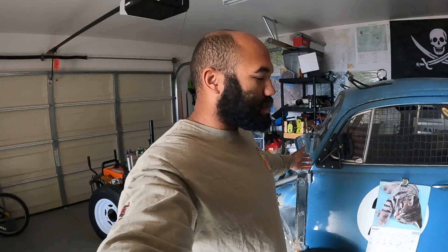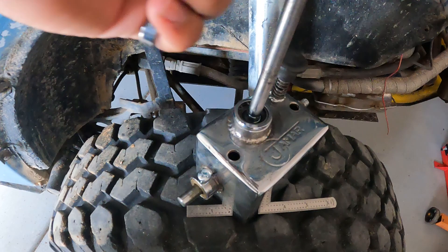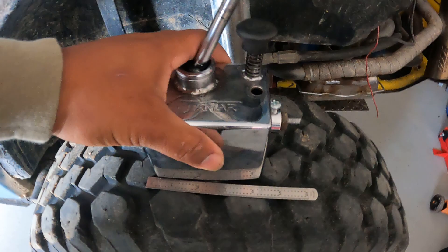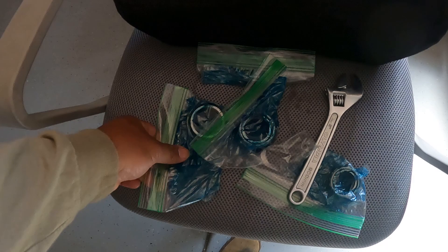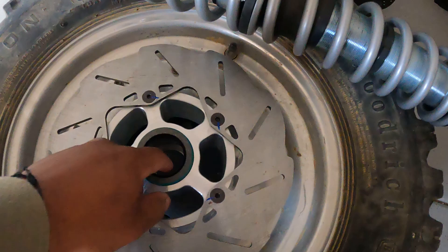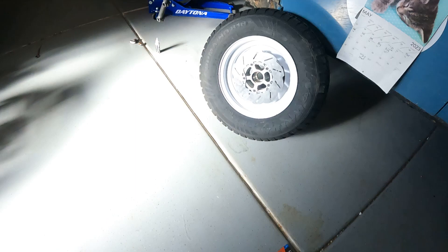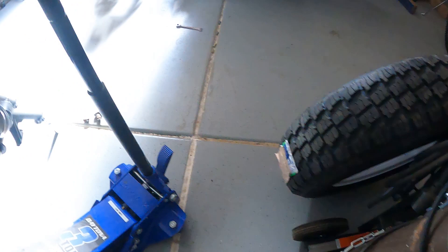It's a new day — didn't get as much done in the last two days as I wanted. The main thing was I got the shifter all done. I got these screws in here temporary because the zerk fittings are garbage. I did not end up hitting the 3x3 arm with the wire wheel — that thing's still in the package. What I did do is pack the bearings, kept them in bags because I really hate grease everywhere. I was thinking about assembling the hub and spindle but the tolerance on the combo snout for the bearings is super tight.